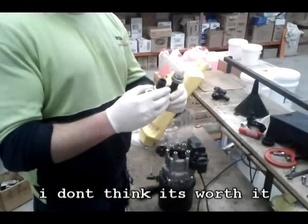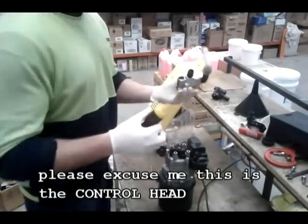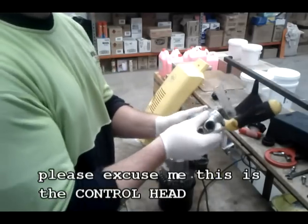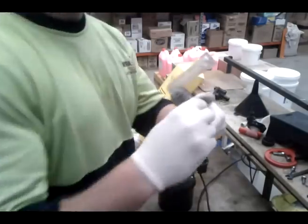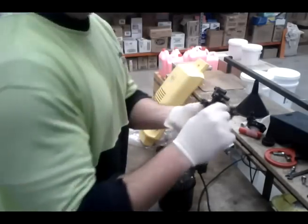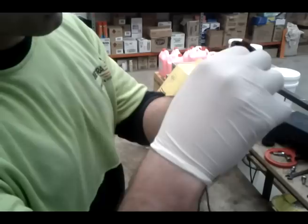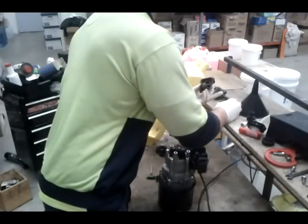Now, how to disassemble this cylinder head? When you get to this, as I explained before, first you want to get this metal casing off by tapping it like that. It pops out here. Next stage, once this metal cap's off, you can pull it off like this. Okay. Next stage, you want to take this little triangle section off, just by twisting around, and it comes off. Don't lose the spring on the inside. Don't lose it. Just place it down carefully.